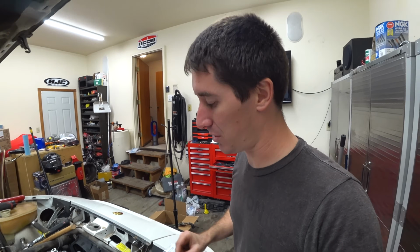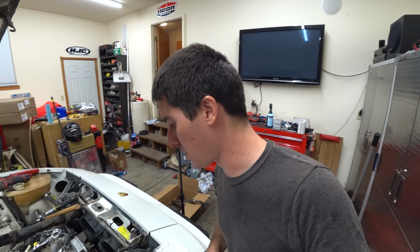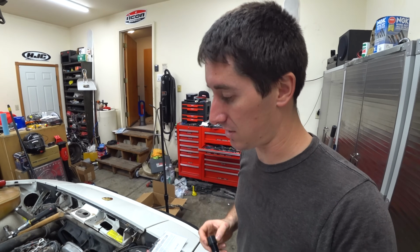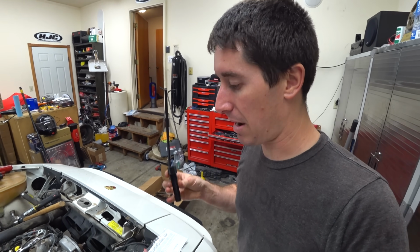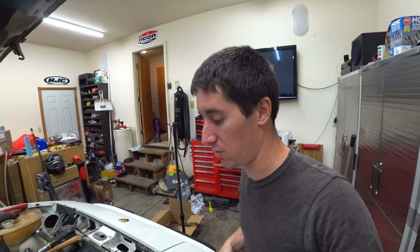Then I'll tighten the bolts down on the oil cooler to 20 Newton meters. I think they're M8 bolts, 20 Newton meters should be the spec there. And I think this helps align the gasket and the housing itself, but it might make it tricky to get it all worked back up through the exhaust, basically, where I pulled this through.